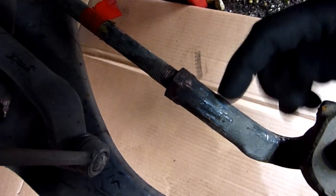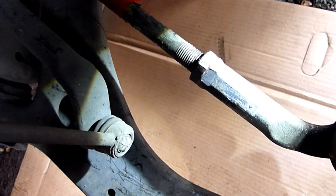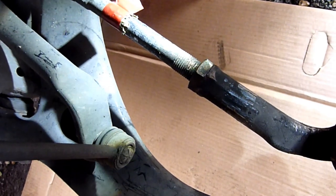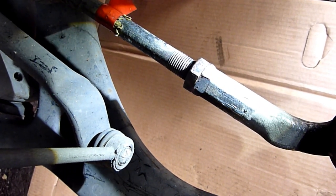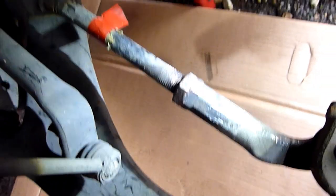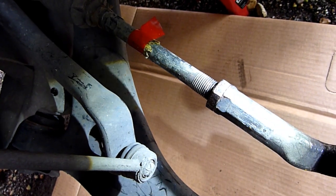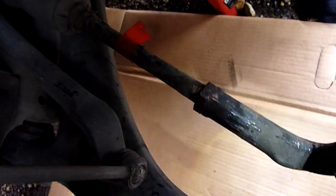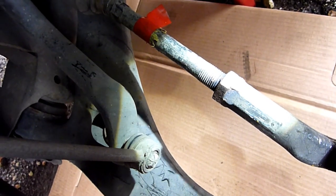Right, so change the tracking. I did manage to loosen this tracking arm from there — this nut was stuck, and so was the tracking arm. You can see where I've clawed it with a pair of pliers. I could — I have already adjusted it for the toe-out that I need. Because that's what the original job was — that's why this video is about the stuck tracking arm. However, I can't change the tracking on this car very easily now because what should happen is I spin this and it will push in and out freely, but not at the moment.